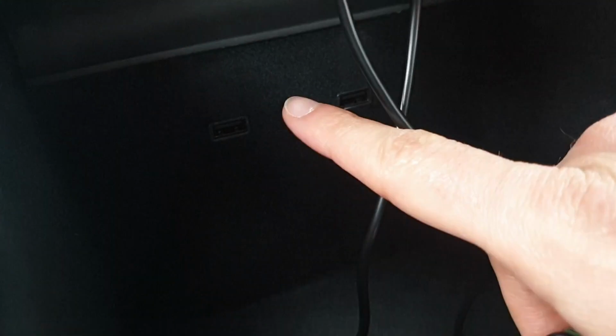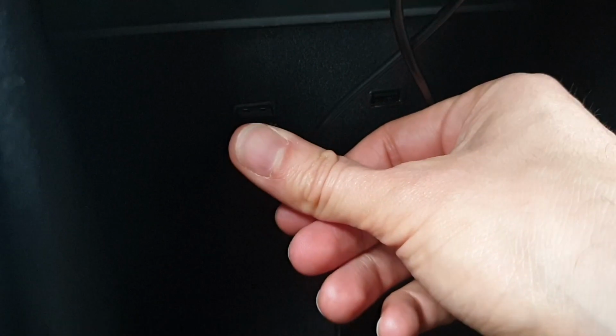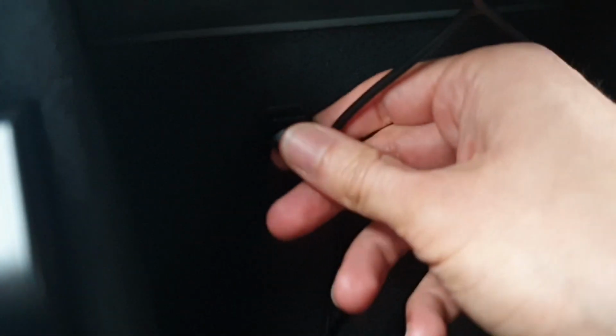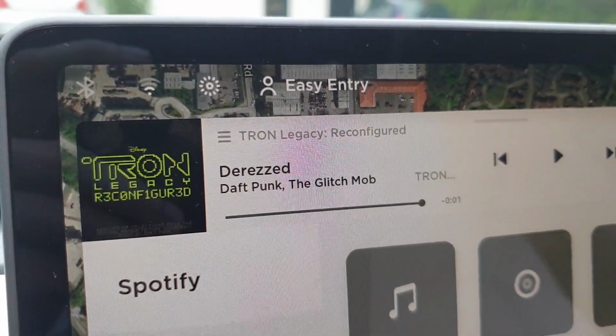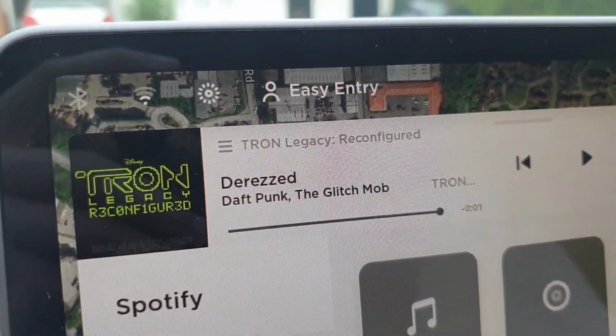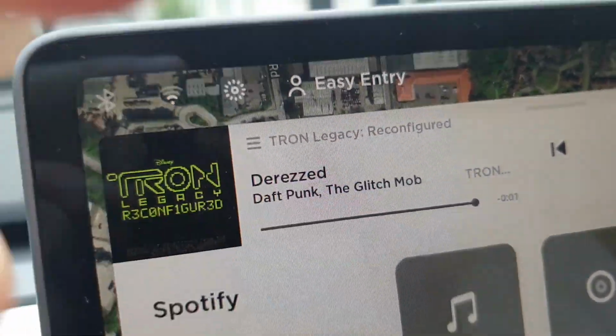And also what makes me think it's not this as well, because here you go, the hub is now out. This is just the native bare bones naked USB port socket. Here's the thumb drive with the micro SD card in the back. Let's just plug this in. There we go. So that's now in, and one in twenty times this will work, if that. I'm thinking it's getting even less now. But yeah, see, look, nothing. I'm not getting that little dash cam icon up here at all. Strange.